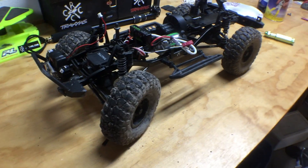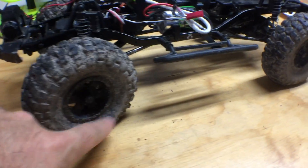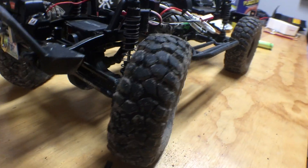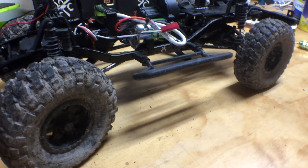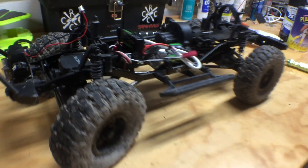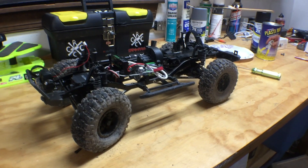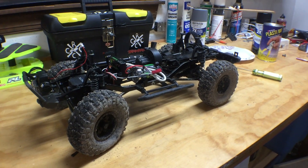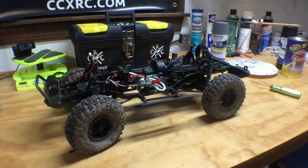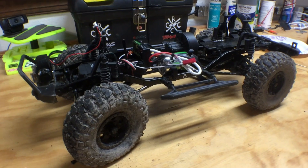That's what I'm working on right now. I've got to strip down the axles, put some marine grease in there on the bearings. This really hasn't seen much water — there's a little mud on the tires, but I've only gone not even axle deep. Everything should be fine as far as corrosion or rust inside the axles, but I'll tear those apart, see what I've got, add grease as needed, and get this thing waterproofed and ready to hit some water and mud.